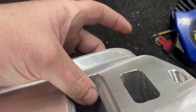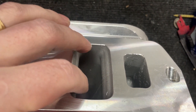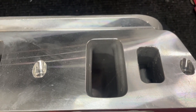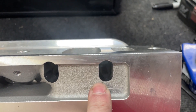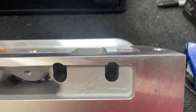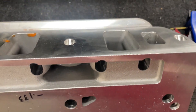That sucks. Usually they're straight, and I'm afraid if I make it straight I'm just going to break through. Some of you might say, 'Well, just put sleeves in there.' But there are tubes in here and it's an oval shape, not round, so sleeves would be very difficult to seal properly. And epoxy — epoxy comes out, especially on this Chinese aluminum head. I'm not sure if the aluminum would even bond right to the epoxy, and it'll flex and move more than it should.